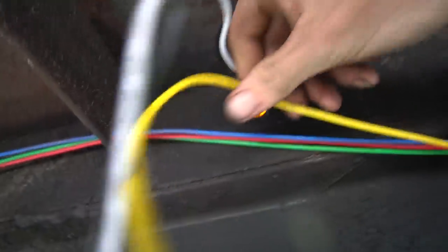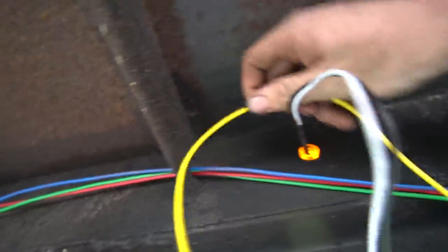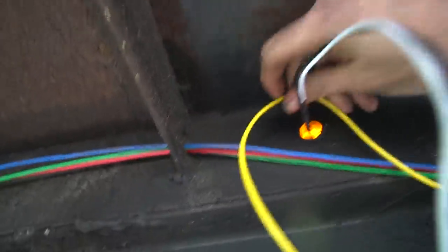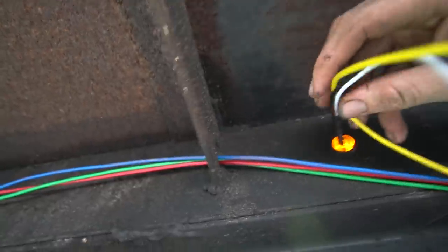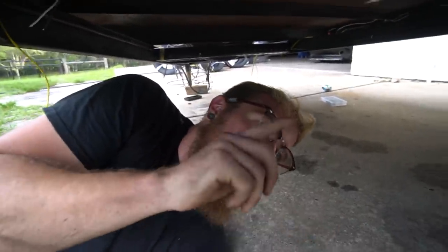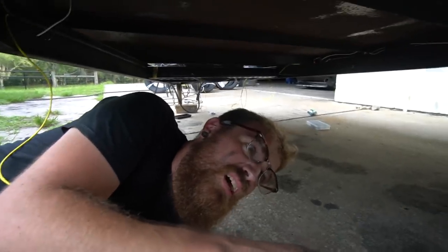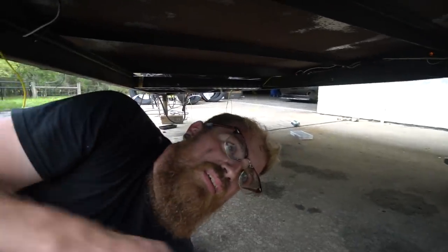So anyway, that's my brake wire. So you can see we got them all ran. Over here we've got our yellow, so this is our marker light. I just used yellow because that's for reverse lights, and I don't have reverse lights. But I obviously plug it into the running light port on that junction box, just so I have different colored wires. So I think I might try to knock out the brakes, the passenger tail light, the center clearance light, and then come get these last.